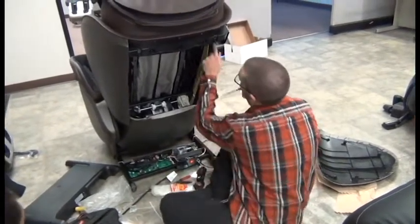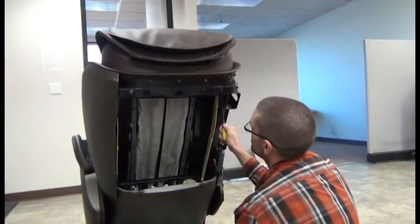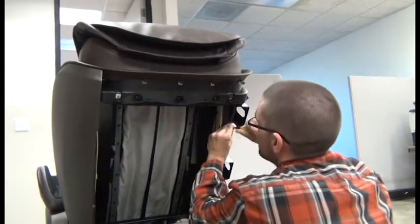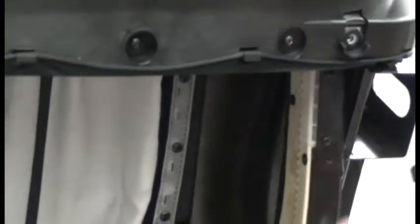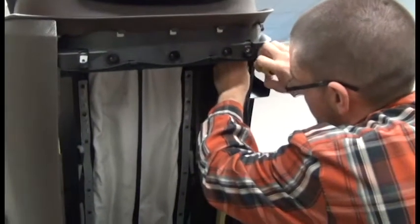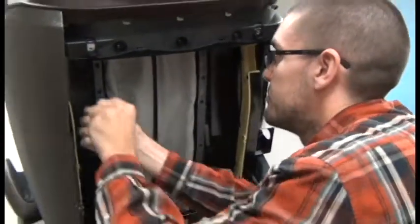You're going to remove the white block covers using the screws furthest away from them — the interior screws hold the white block to the black bracket. We want to remove the bracket with the white block, so just unscrew these; they're just standard Phillips head screws. If you lost one, these are interchangeable and the bracket will slide off to the left. You can use a screwdriver to give it a little nudge from the side — it's just grease-mounted in there.